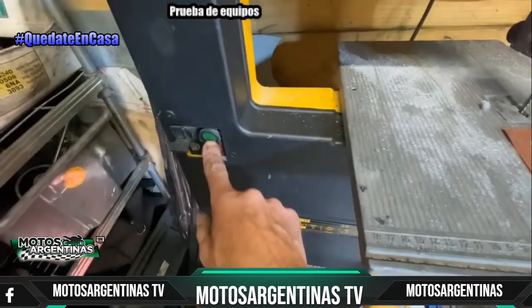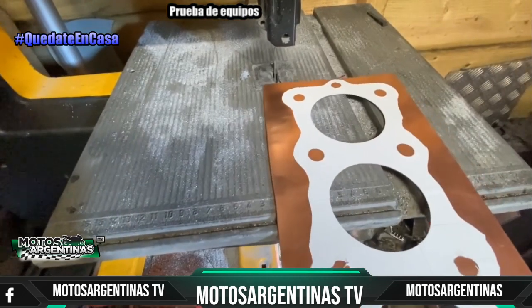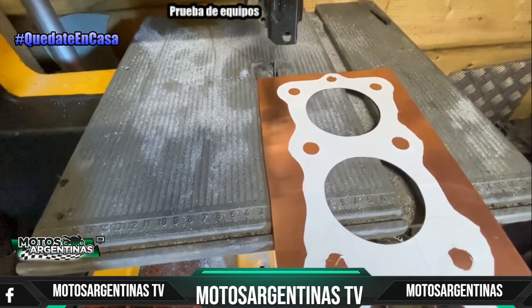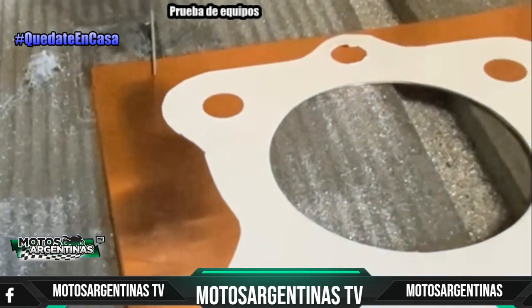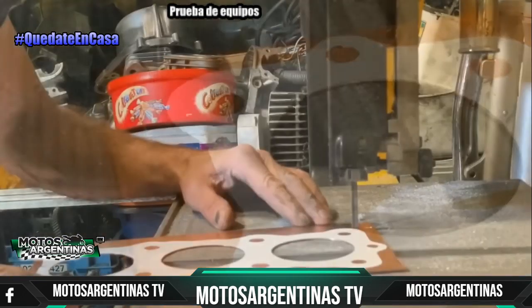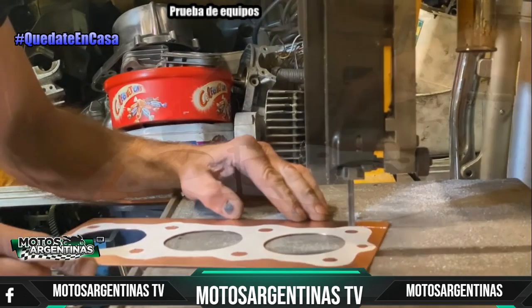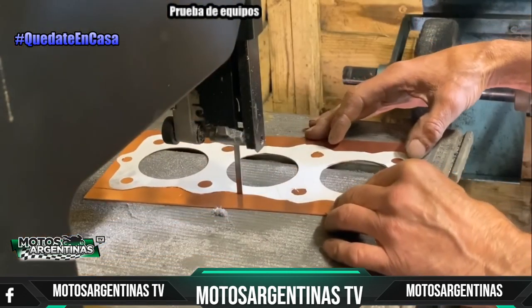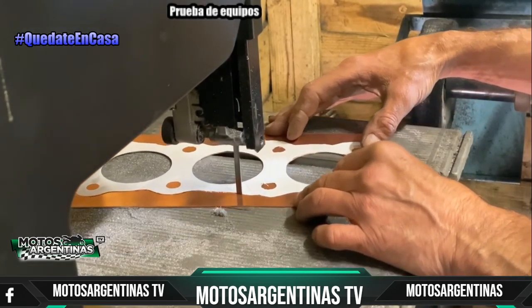Back in the shed, I used my bandsaw to cut out the gasket, following closely the edge of the sticky back plastic template. When using the bandsaw, it's important to let the blade cut through the sheet. Don't try and force it through, and keep an eye on the edge when you're doing your cut to make sure you follow the right shape. It can take a while, but the end result will be worth it.